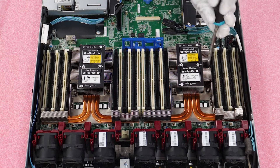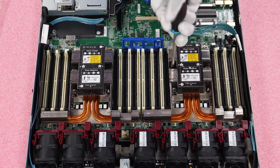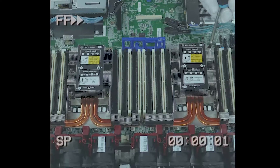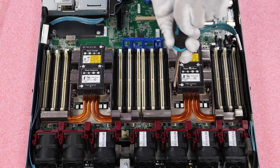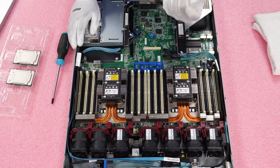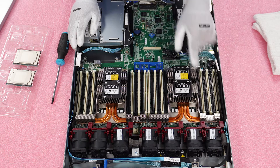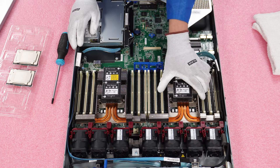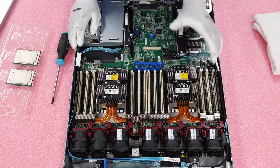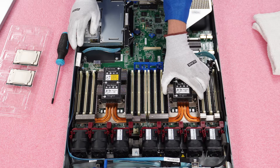This is why I like the manual screwdriver — you can really feel the heat sink coming off the motherboard and getting loosened up, so you can tell if it's still in there. Now we'll do the two outside ones. Now that the screws are loosened, we're going to lift the heat sink straight up. Once it's all the way up, I like to flip it over just in case there's any thermal paste sticking out the side. As soon as you lift it, the pins are exposed — so be careful that no thermal paste falls in there, as that's the worst thing that could happen.